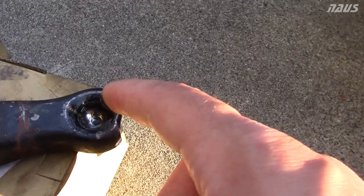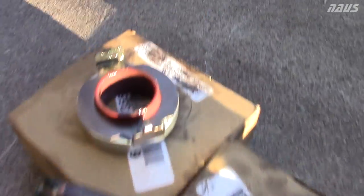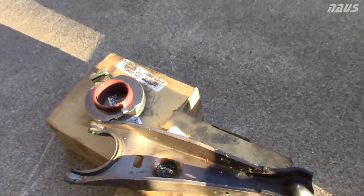The last part is where your slave cylinder pivots. The slave cylinder pushes the ball out and pushes on here, which tilts the arm to push your throwout bearing into your clutch pressure plate. So you want to stick some grease in there. Now you've got the shaft greased, a little bit of grease on the splines, some grease on the pivot ball, the end of your forks, the inside of the throwout bearing, and where the forks contact the bearing.